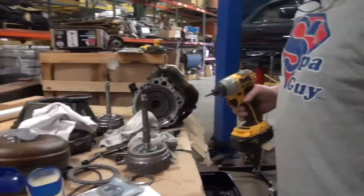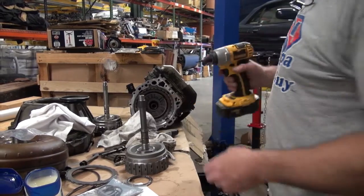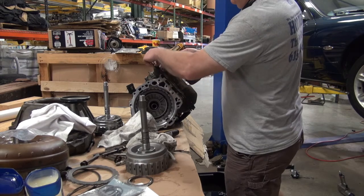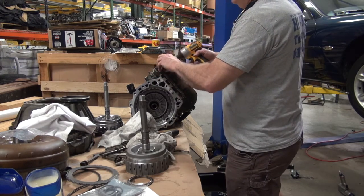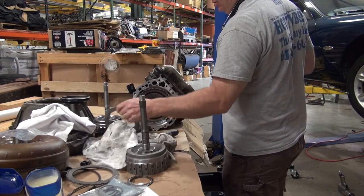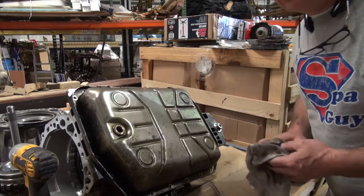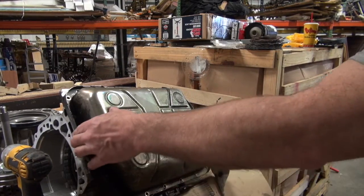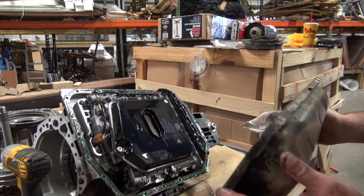So your bit to take the pan off is a Star Tool T25. And so we're going to start easing it off. And don't go crazy torquing on these things. Just go easy. Everything's moderation with the automatic transmission. So I'm going to pull this off, and I'm expecting to get a little fluid. I hope not too much. Actually, not any. That's good.